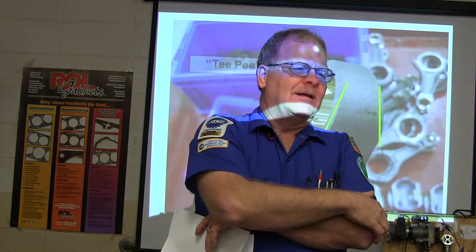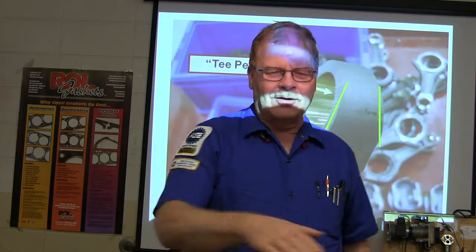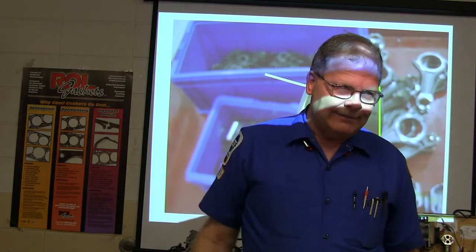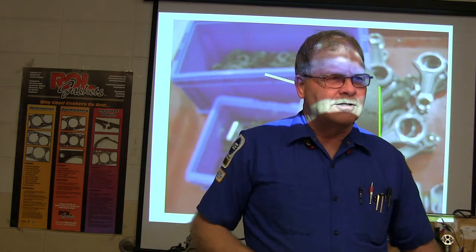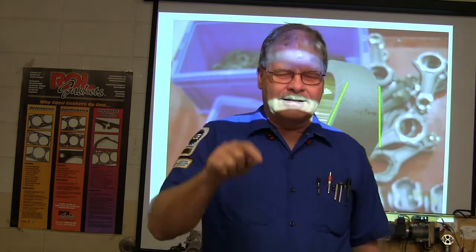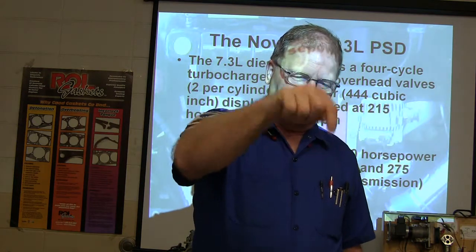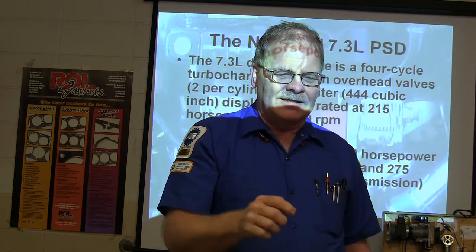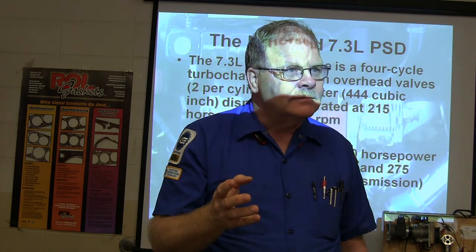I was driving this little Volkswagen Bug, a '66 Bug I had one time, and I pulled into the parking lot of this convenience store where my wife was working at the time. And this was way back in 1981. I was a pretty good gunslinger on that park brake, if something didn't happen. But this thing, the way the brakes were done, it had a little brake fluid reservoir in there where the spare tire goes, and it had a little pipe going down to the master cylinder into a little grommet. And sometimes that little grommet started to leak a little bit, and I wound up with no brake fluid and didn't know it.